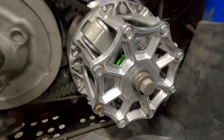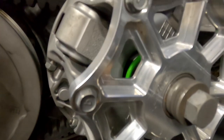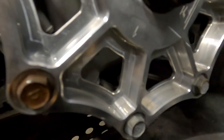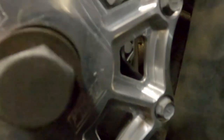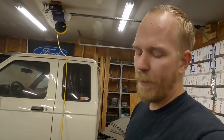All right, blew most of the dust out — let's take a closer look. This is the billet clutch cover. It looks really nice. V-Force John was claiming this would blow apart, but that simply is not true. Billet aluminum is much stronger than cast aluminum — the stock one is cast, and this is billet, so even with the holes cut into it, it's a lot stronger than OEM. Those holes leave ribbing for reinforcement while taking out a lot of weight. Looking closer — it all looks pretty good. A little bit of wear along there, which is pretty normal. There's no big gouges, the shoes are nice and clean, and there's no grooving that I can see. I'm pretty impressed with how well it's held up after a year of hard riding.